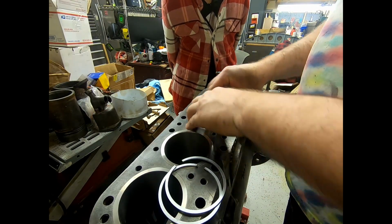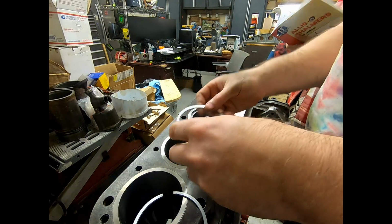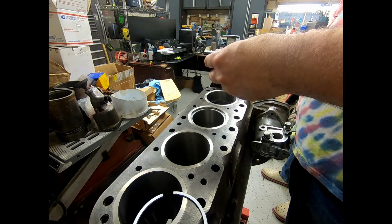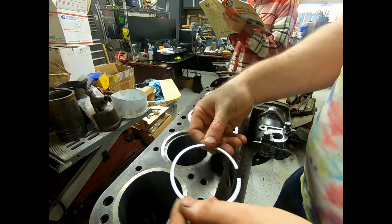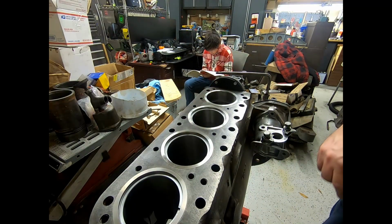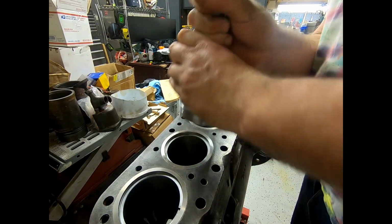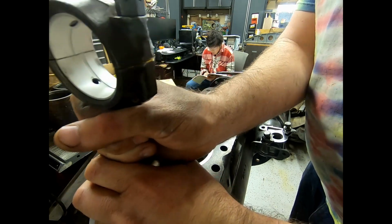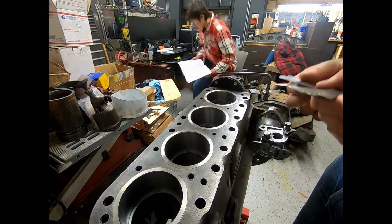So look in the manual, see if you can find piston rings, and you're looking for piston ring end gap. Pistons, liners, and rings. So read this section. It should give you a listing for the recommended piston skirt clearance. No, we want piston ring end gap. Some are fitted with 4 rings. Recommended end gap for all rings is 0.007 to 0.017. 7 to 17 thou? I guess so. All right, good. We don't care about the skirt clearance. 7 to 17, you said?